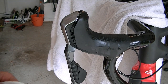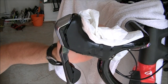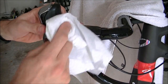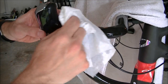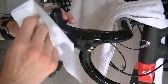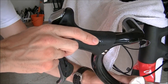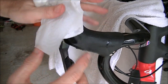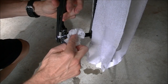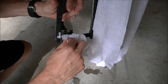I highly recommend taking a paper towel with some isopropyl alcohol, dousing the towel, and wiping everything down really well. Before you do this, go wash your hands thoroughly. The Shimano mineral oil is not corrosive, but it will destroy your brake pads — it makes them slippery and useless. Make sure there's no oil on the grip surface of the lever, and wipe down both the lever and the caliper before you put the brake pads back in. Then go wash your hands one more time before installing the pads.